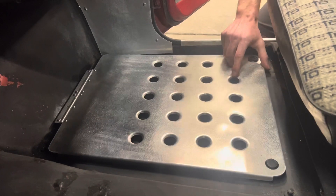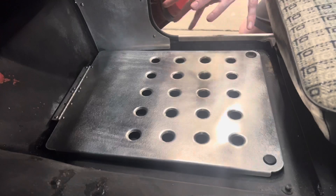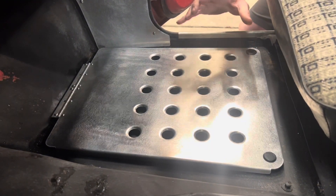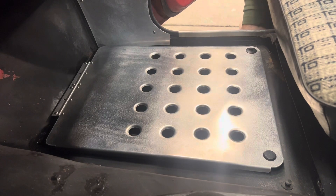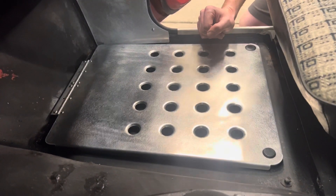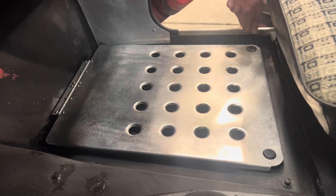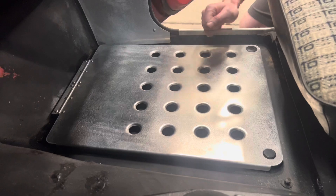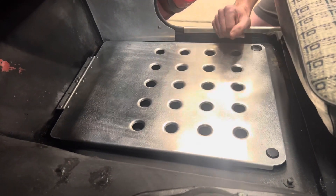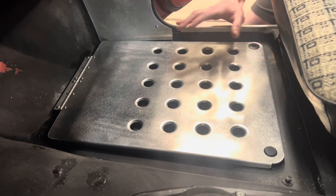When starting, position the heel plate in the desired location in your truck. One thing to keep in mind is that underneath it there is some structure and framework — you might have rerouted brake lines, fuel lines, things like that. Be aware of where that is, because if you're drilling holes or putting screws through the floor, you want to make sure you don't hit any of that. That's a good check to do before you get started.